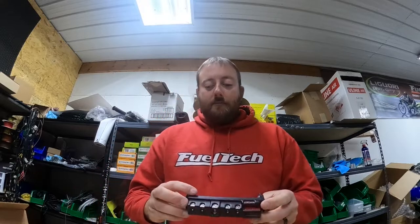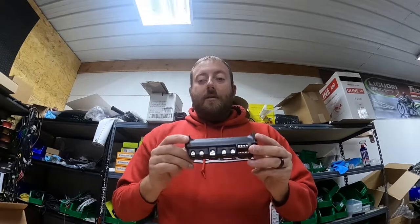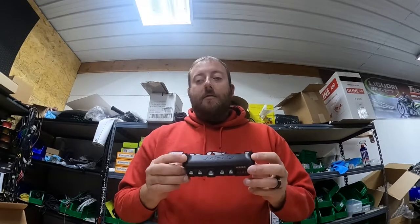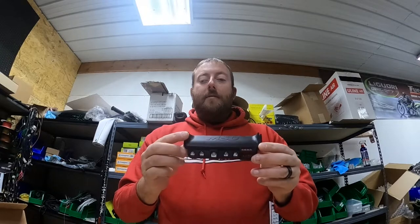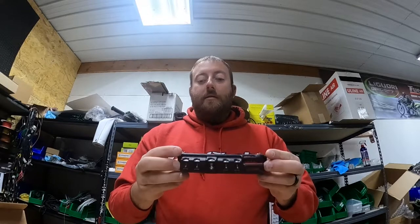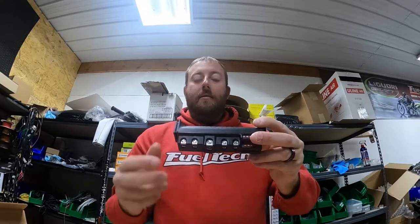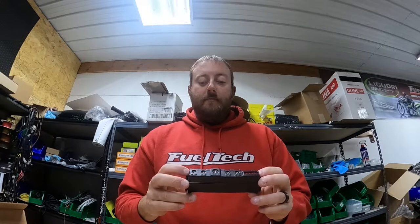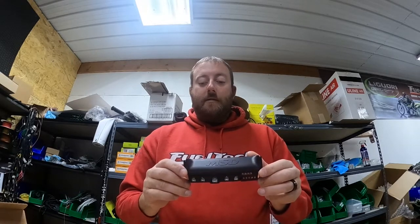On the other side of your fuel pump you need to ground it to the battery. This relay has over-amperage protection — this specific relay is 20 amps, so if it goes over 20 amps on any of these outputs it will shut that output off. They make a 35-amp version; I've never personally had to use it. I've always used the 20-amp and never had an issue. If you have an extra lead you can double these up for twice the amps.